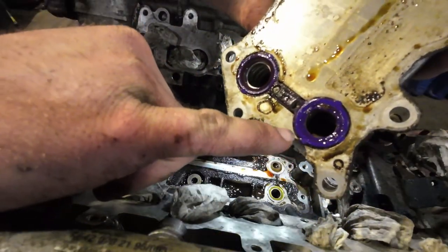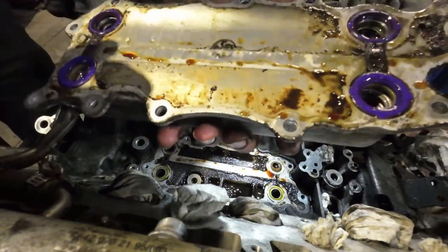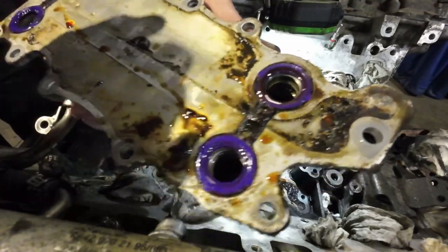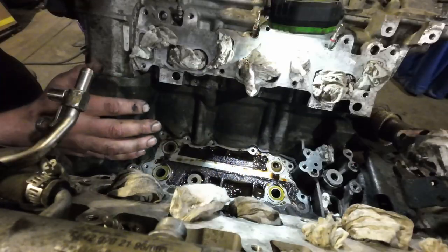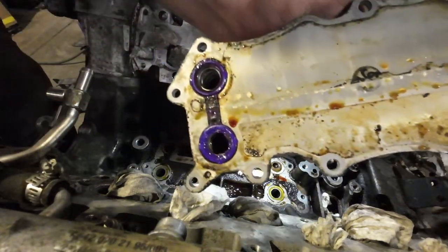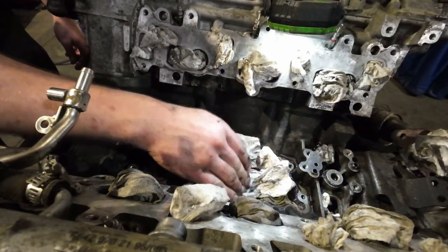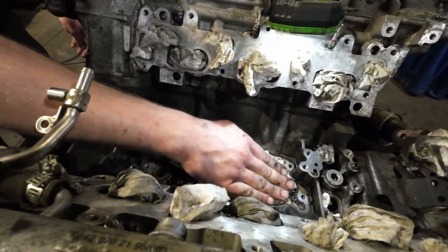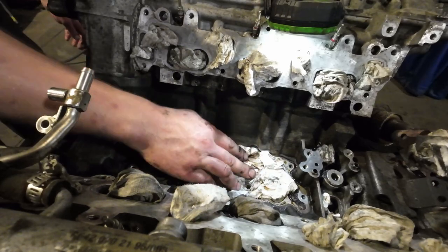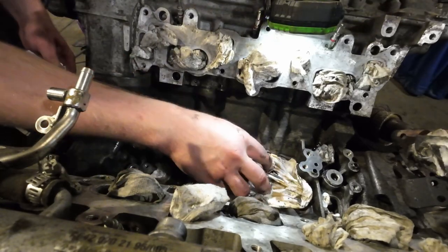Well, we do have one that is flattened - it's not the worst I've seen but it's not good. That one's flattened as well. For some reason both the ones on this side look fine - I don't know if it was a torque issue. I'm hoping that this was it, but anyway this is good preventive maintenance. I'm going to go ahead and get all this cleaned up, get those gaskets pulled out and cleaned up - I've got new ones to put in. Shove some rags in the holes to keep all the crud out.